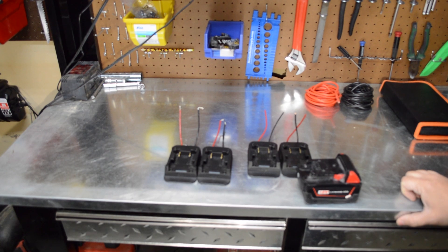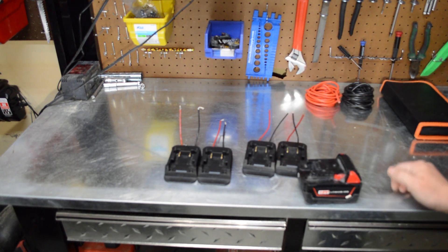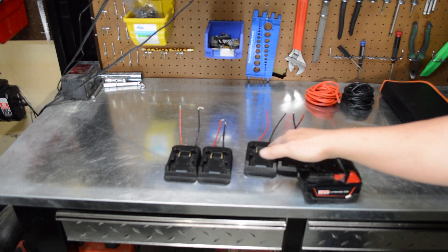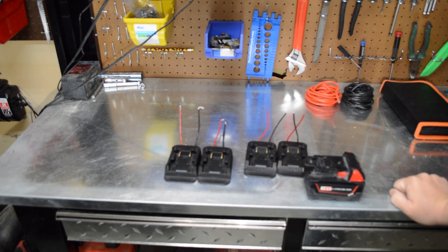The Monster Moto E1000 is a 36-volt system, so I could get away with two adapters, but I decided to go for four. With two batteries in series you get 36 volts since each battery is 18 volts. I'm going to do parallel and series so I can run four batteries and get a little bit longer life. Testing showed that on two batteries, when I was really pinning it as an adult, it started losing power — so four batteries in parallel and series will give the full amperage needed.